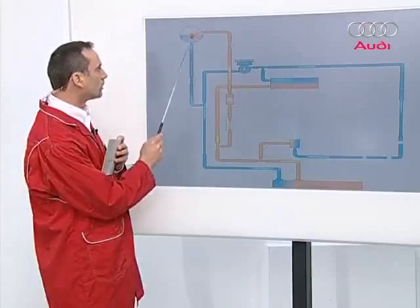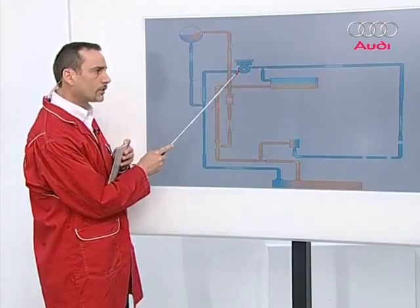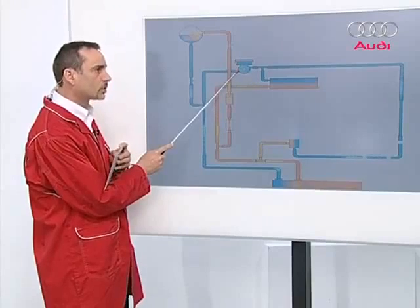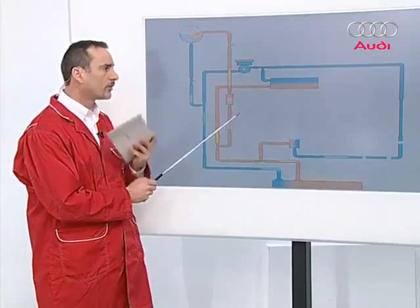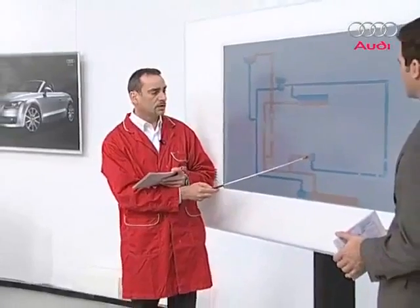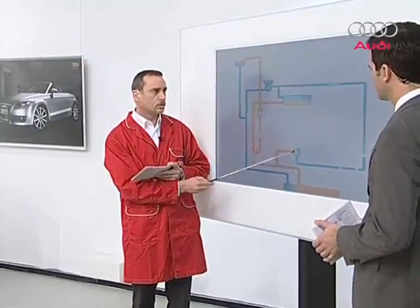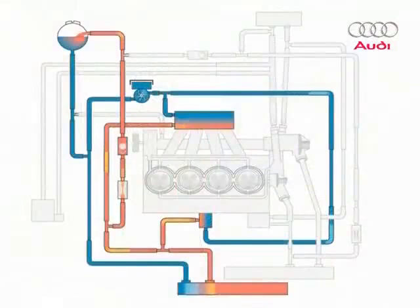This electric auxiliary pump — the run-on pump — is only activated when the engine control unit deems necessary, so we require two sensors: one in front and one behind the charge air cooler to measure temperature. If the map-controlled cooling system deems it necessary, the pump is activated. The turbocharger is also in this circuit. The whole cooled flow cycle stays relatively cool throughout, and the turbocharger is significantly more efficient because it is well cooled.